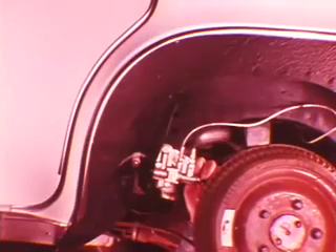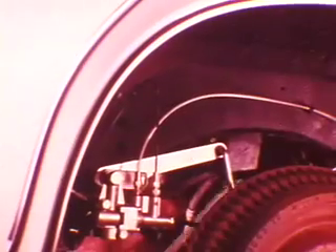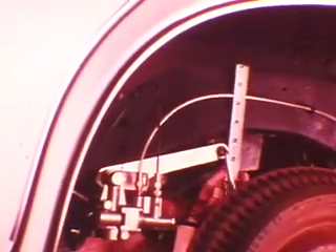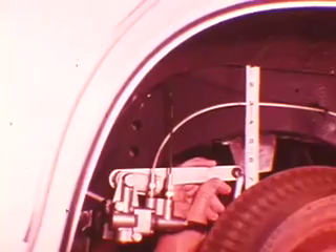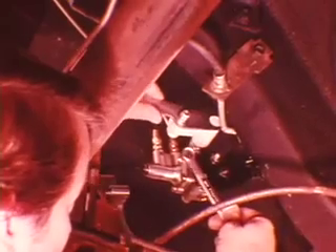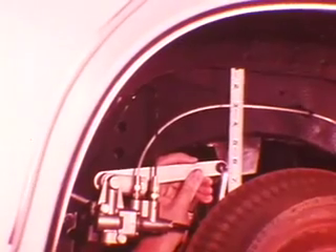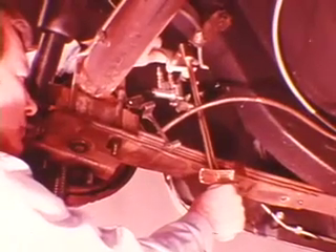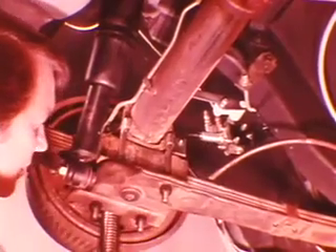While you're in this area, make a quick check of the height control arm setting. Without any pressure on the arm, measure the distance from the center of the linkage grommet to the upper wheelhouse inside the frame flange — specs call for six and one-quarter inches. When it's out of specs, loosen the adjustment nut. The control arm will move freely up or down without changing the neutral position of the nylon block. Set the control arm to six and one-quarter inches, then tighten the nut to 45 inch-pounds. Recheck the setting. Reinstall the linkage clip — place the front section on the U-bolt and tap it into place, then the rear section.